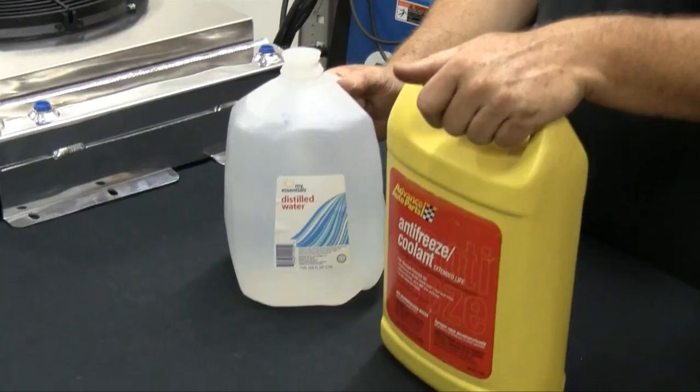If you can't get softened water, use tap water. If you use distilled, you're going to need a 50-50 mix between antifreeze and distilled water, because distilled water will actually start pulling ions out of your aluminum or magnesium or whatever inside your engine and inside your aluminum radiator, causing it to, for lack of a better term, molt - and it'll start eating away at the aluminum over time. I've always put distilled water in it, and now I've learned that distilled water is not the best thing for your radiator. Just get some old tap water - it'll be fine.